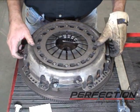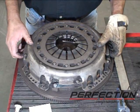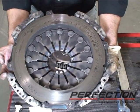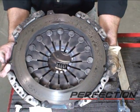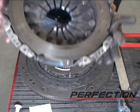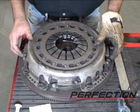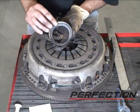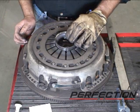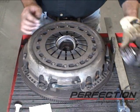This is where things start to get ugly. As you saw when we removed the transmission, the clutch release bearing just fell apart. There was nothing left. The flywheel side of the pressure plate, we're looking pretty good there. The clutch disc side, it's a little bit hot, but I've seen a whole lot worse. So what caused this bearing failure? Was it a bad bearing? Well, there's the bearing race that rotates up there, and as you can see, it just burned a hole clean through the diaphragm spring fingertips when it stopped rotating. But I think we have to look a little further than that.